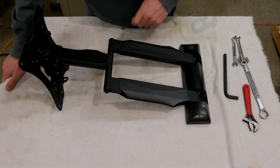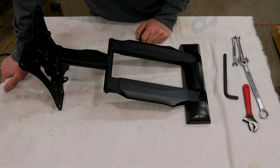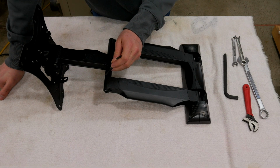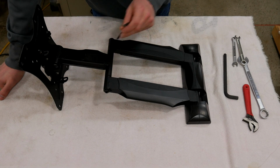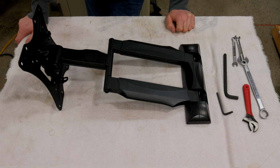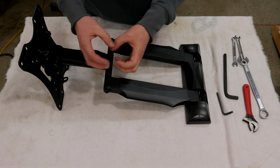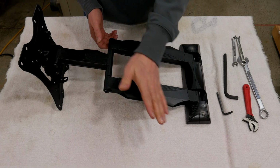of the joint, there was enough leverage and pressure that I'm not sure which mechanical property of the steel was overwhelmed, but essentially you would get deformation of the arm or the tubing above the joint and below the joint, and you'd also get quite a bit of bad galling. In my opinion, I basically just overcame the compressibility of the steel, because what would happen is it would just compress, and it would basically mushroom inwards and outwards to the point I couldn't even get the actual pin that I had through it out.